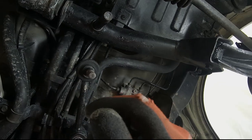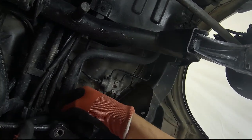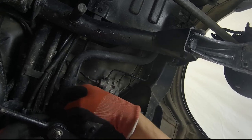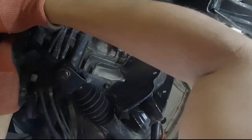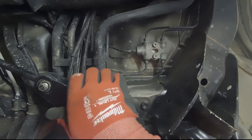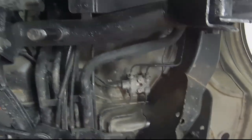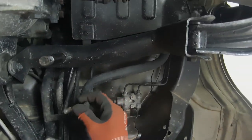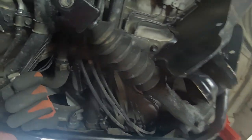So here for this, some people call it a dog bone. There is a special screw that has a square head that seats inside of a seat so it doesn't spin. I think this is the one that you have to fully extend, and then you can clear that bolt right here. You can clear it here, otherwise you got all these tubing and pipe in the way. And whatever you do, don't lose this, because this is sold separately. This will be the next thing to go. The lower control arms.